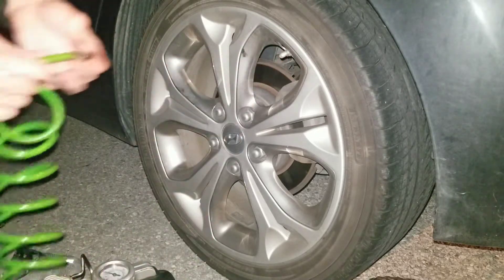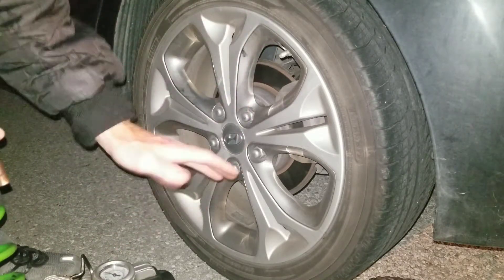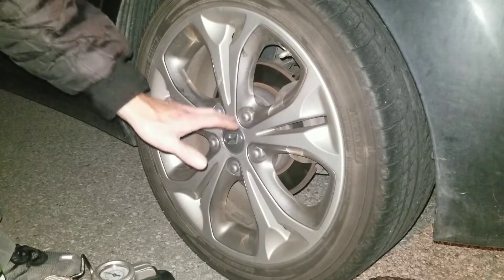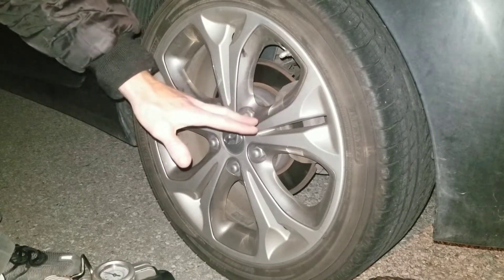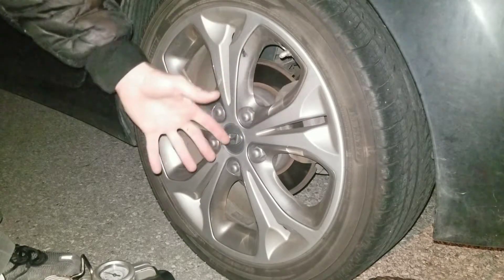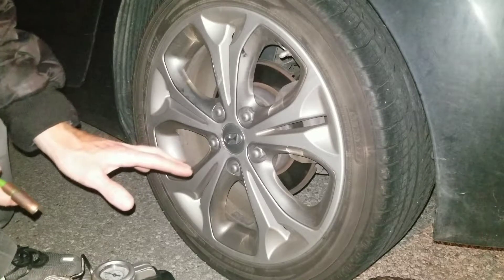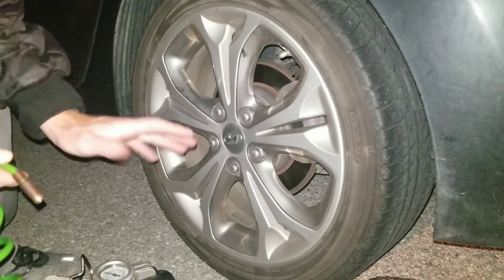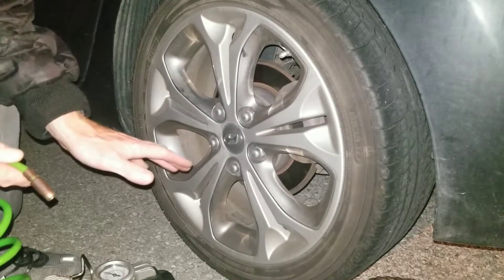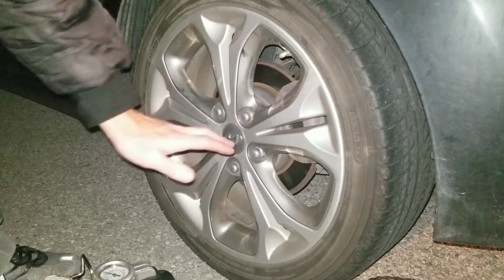You want to take this off and make sure to check your pressure first. A lot of people are confused about this: if you're looking for what your tire pressure should be on the inside of your door or glove box and it says recommended pressure from the manufacturer at 35 PSI max pressure — if you've changed to non-stock tires, meaning they're not the same type as the original tires, then you want to go by the new tire manufacturer's pressure rating.